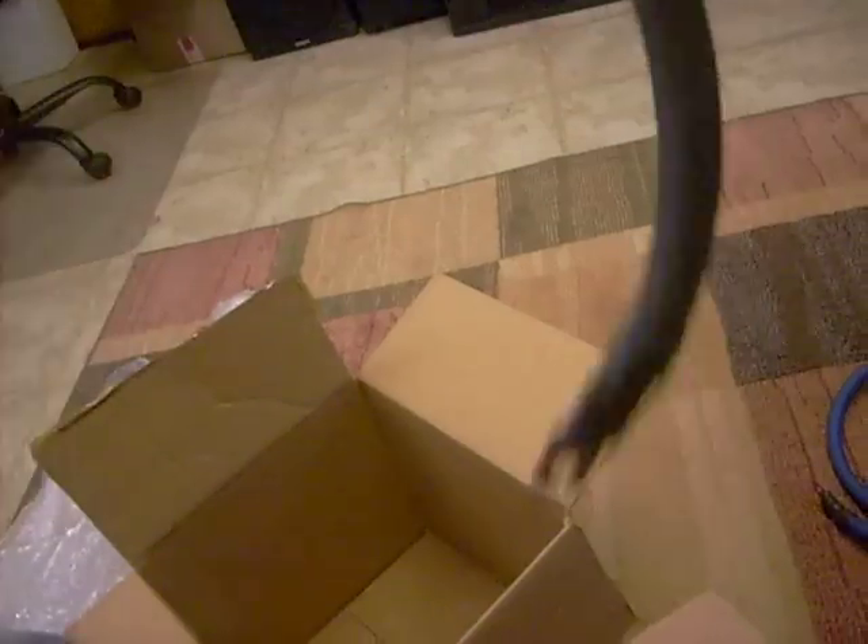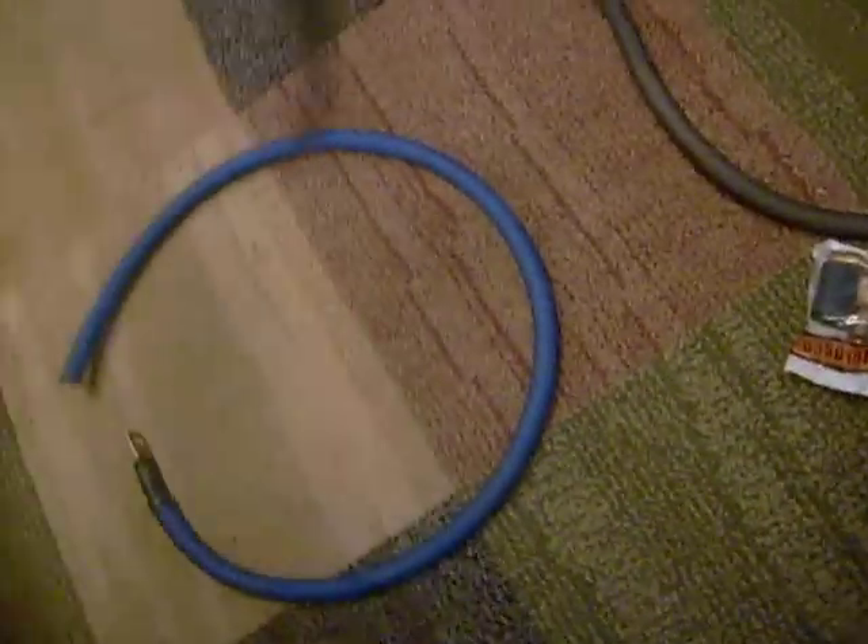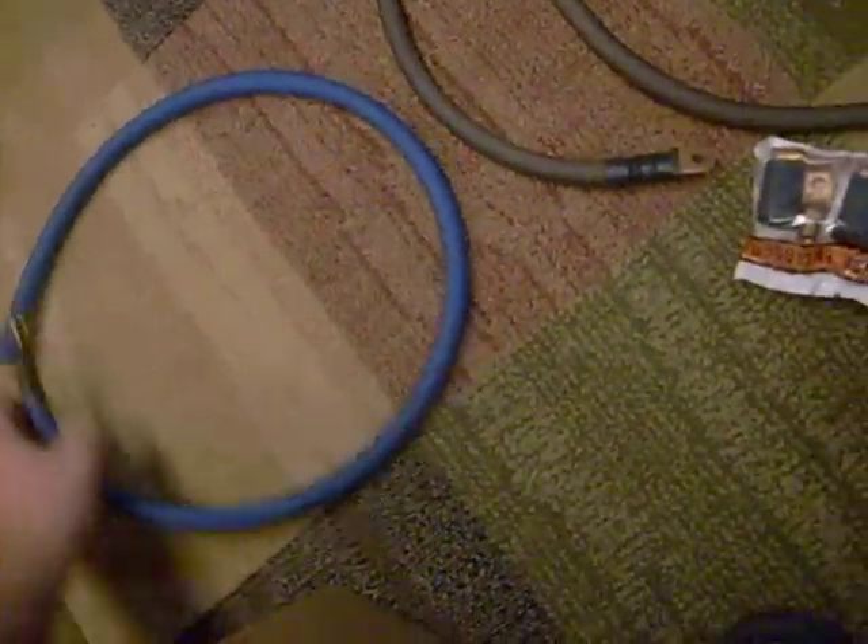My second 2200 is gonna be here on Friday. They did give you three pieces. Initially this would be alternator power to battery, ground on battery to your chassis, and engine block to ground. So there are three wires there for the big three.